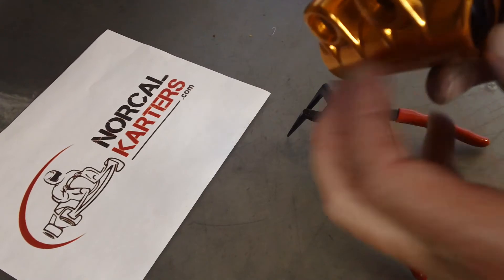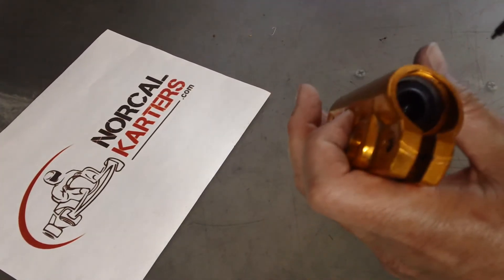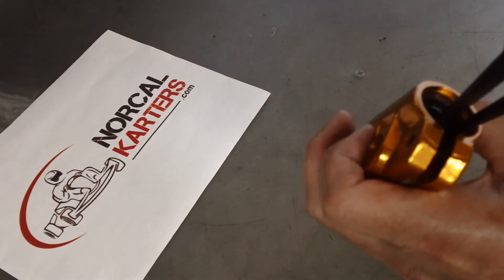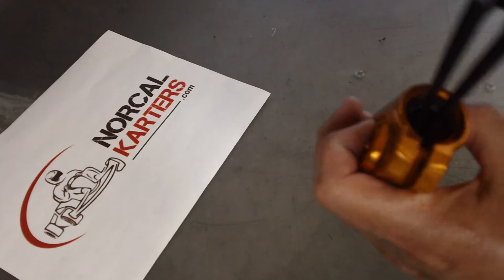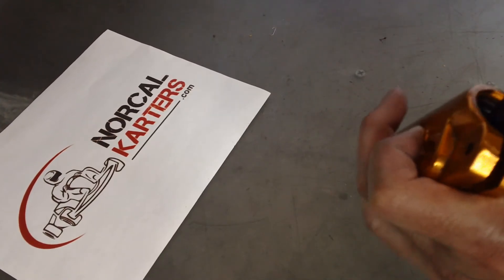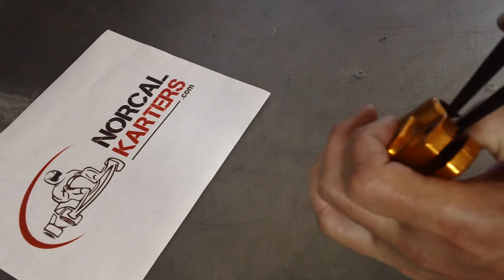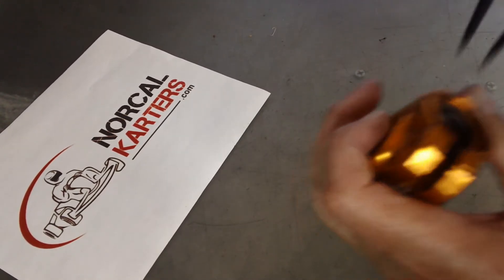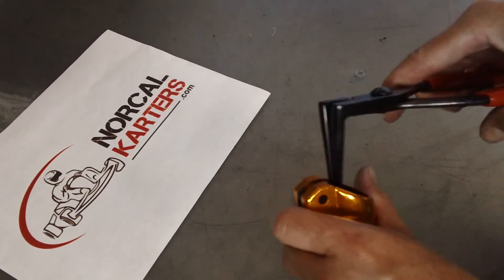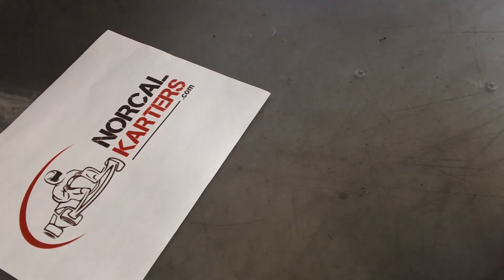In this example I'm not quite in the groove — see how it's floating around? That's not quite right. So we take it out: reverse the step, use the circlip tool, squeeze, and remove. When doing master cylinders or brakes, keep in mind they are often spring-loaded, so do not aim at your face or a loved one. If you are going to aim it, make sure you aim somewhere where you can find the parts later.